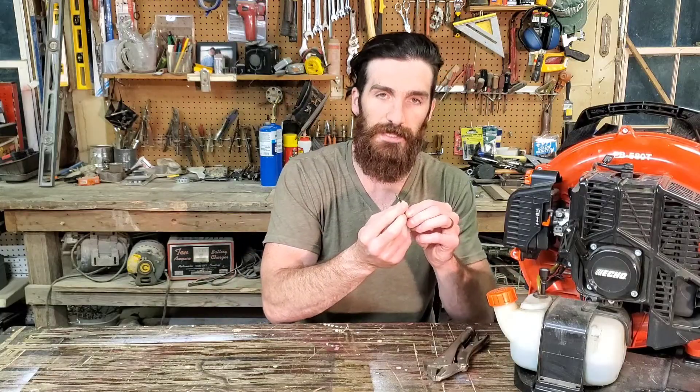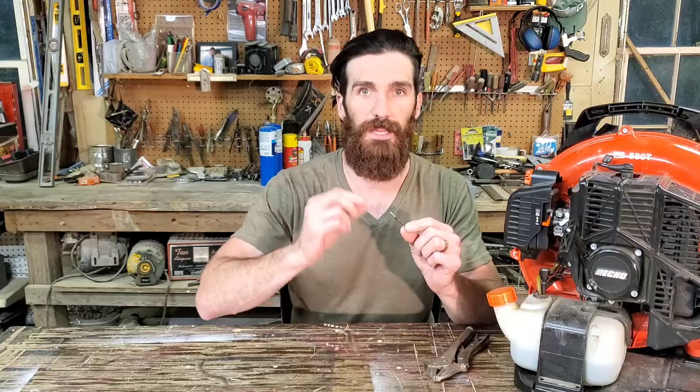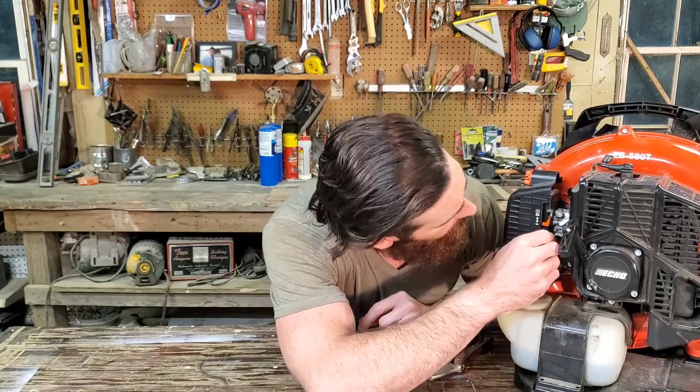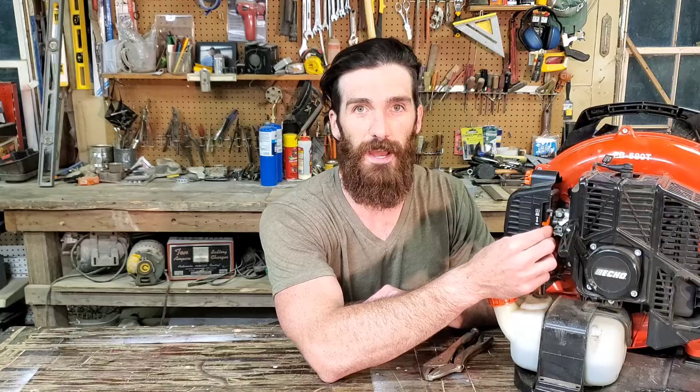I have a chainsaw grinder and I just ran the pin up against it and filed it down until I got it the right size. If you don't have a chainsaw sharpener, any type of grinder will do — even a belt sander or orbital sander — anything where you can take off some material on the metal roll pin to make it small enough to fit, and shape it a little to get that D shape. Once you get it, it fits right in there and you can make those adjustments on the carburetor.